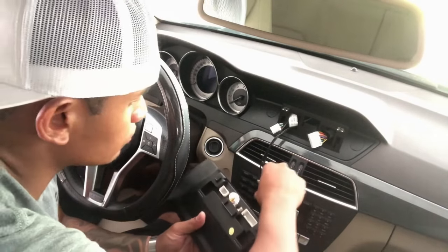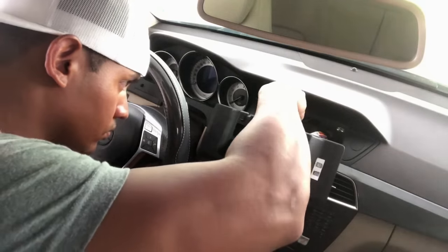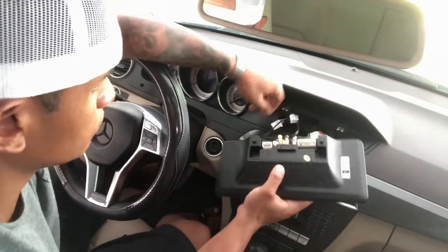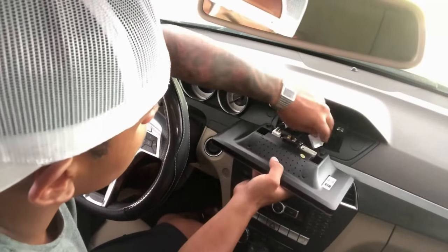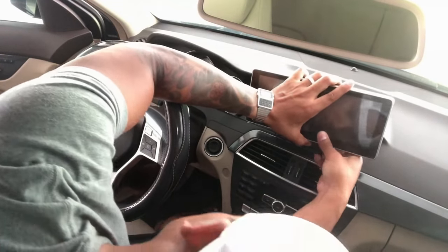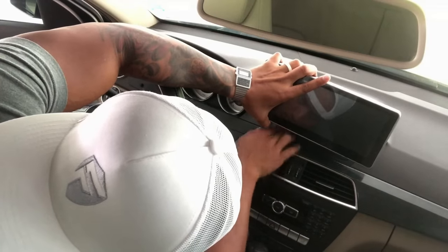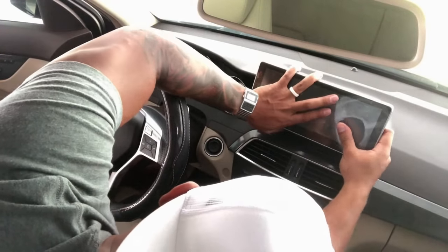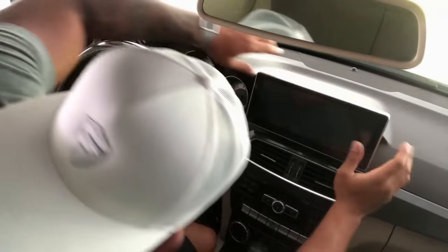Make your five connections on the screen to the five connectors we have. Start with the GPS and the two Wi-Fi receivers, then install the smaller clip, and then the larger clip. There wasn't quite enough slack so I had to hold up the screen to connect it. Once all connections are made, push everything in so it's nice and clean. The screen mounts from the top down and clicks right into place. And that's it.